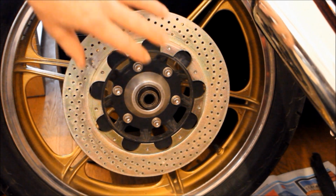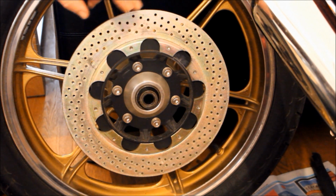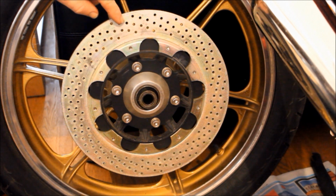And what he did was, he split it all down, had the disc ground, and then it's been plated, sort of flash plated, with a thin coat. I think it's cadmium plating. And that will obviously rub off the first time you apply the brakes, but that's okay. It was just done to protect the iron discs while it's in storage or whatever. So obviously I've not used the bike, and that's why this very fine surface is still there. But once the bike's in use again, of course, this cadmium plating will soon be removed by the brake pads.